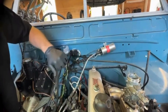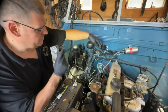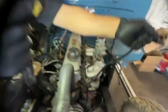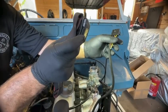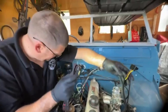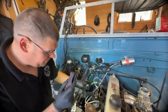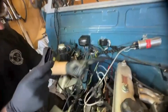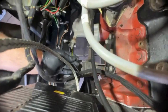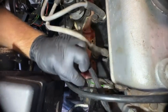This bit of loom is to the alternator. We've got live wires going to here — this is the alternator loom. These brown wires run along here and down to the alternator connection. That yellow wire is a trigger wire for the alternator to the back of the dash. Coming down here, following the loom down, it goes to the oil pressure switch, which is green and yellow.